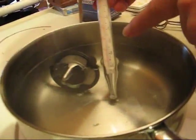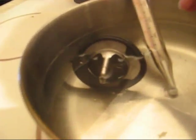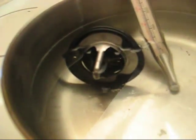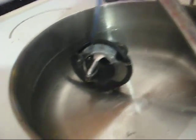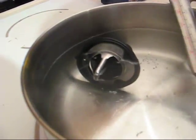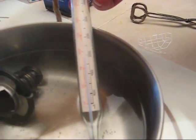We're up to about 170 degrees — let's see, 175, 180, 185 — there's 190 now. You can see, if you look right over here, the thermostat is starting to crack open, and we're at about 190 degrees Fahrenheit.